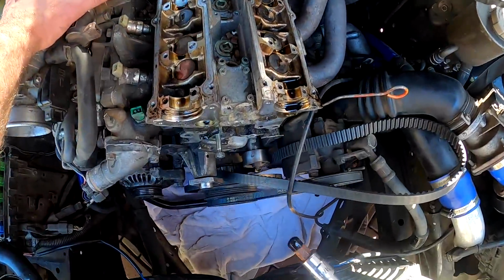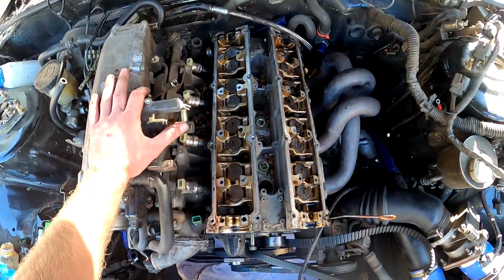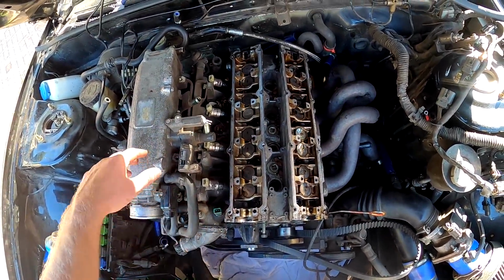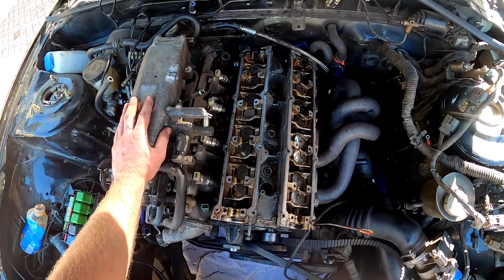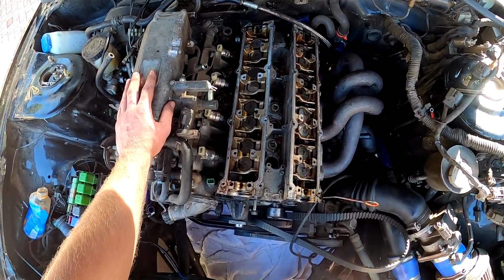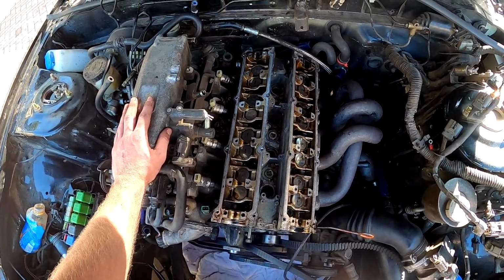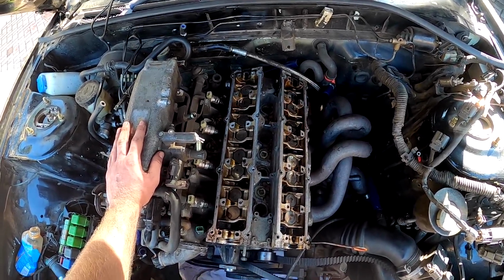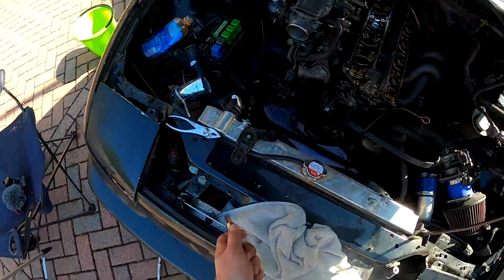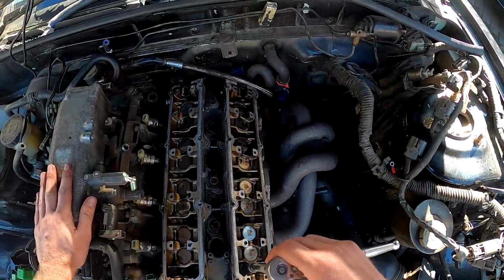I don't know whether this guy has just been running it and it's just not been tight. The head's not been tight because them cams weren't loose. I mean, maybe I'm looking at it from a positive, maybe I'm looking at a negative. Someone's taken the head off, thought, that's messed up, get the head back on. Or the threads are damaged, or someone's just forgotten to tighten two head bolts when they put the engine back together. Let's just see if these are getting a thread.